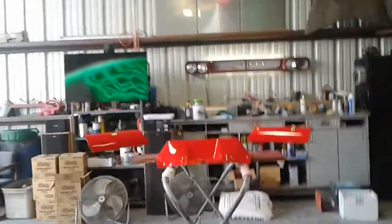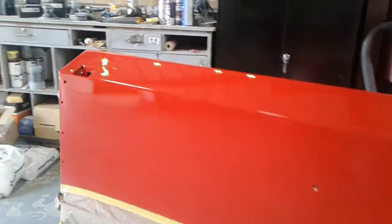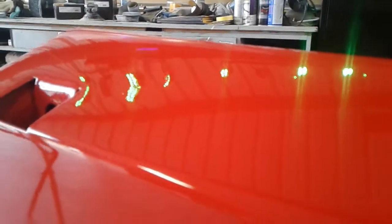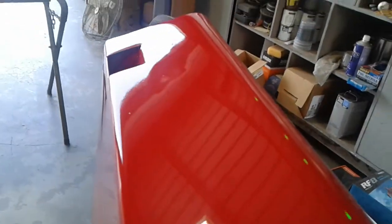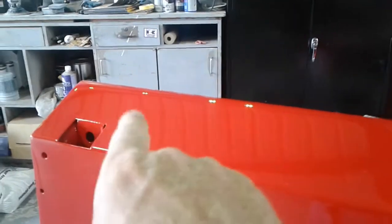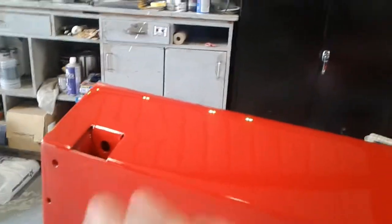Let's see what I got done this weekend. Last time we talked, that had crashed on the floor, and today is Saturday. I've been working on it and got it into body work this week. I put some epoxy down and there must have been still some pits and pinholes in my Bondo, so I put the epoxy on pretty thick, then decided to do a little wet sand to smooth it all out and get it where it needed to be.